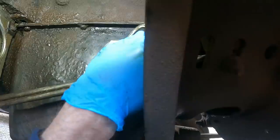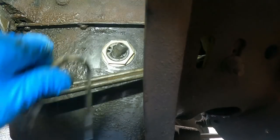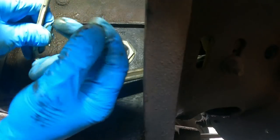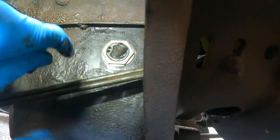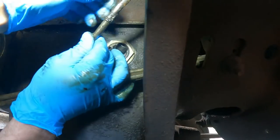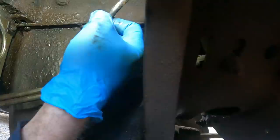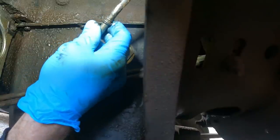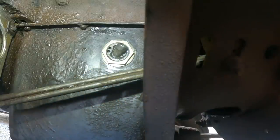This little plastic holding tool had a couple of little retaining flanges on the end of it — just pull her back out. Those little clips held in there, and a couple of times it felt like it was going to pull out. We've got the retainer replaced. Now there is also an O-ring on the bottom of the dipstick tube here. I can see it right there — I'll take that off. Let me go grab a rag, some cleaner, and a new O-ring. I want to replace that too since it was in the kit — might as well.